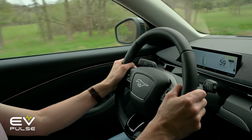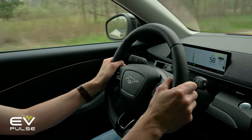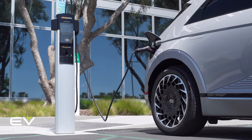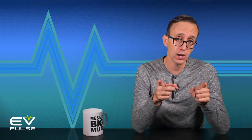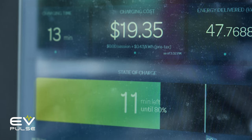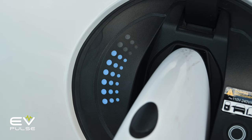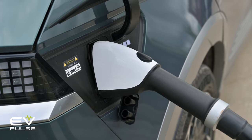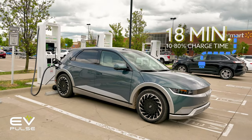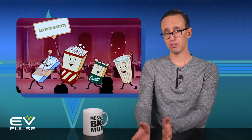But if you are on a road trip and need to juice up your EV, don't seek out a Level 2 charger unless it's the one at your hotel or it's your only option. Though speedy, it still takes hours and hours to replenish the battery. What you want is a DC fast charger — sometimes erroneously called Level 3 chargers — these power boxes are built for speed. They're like the cheetahs of the charging world. Depending on the unit, they can push out anywhere from 50 to 350 kilowatts, enough to replenish a depleted battery pack in just minutes. Cars like the Hyundai IONIQ 5 and Kia EV6 can go from 10% to 80% state of charge in just 18 minutes — that's barely enough time to use the bathroom and grab a snack.